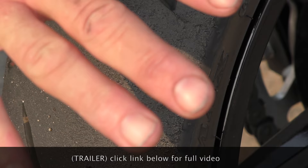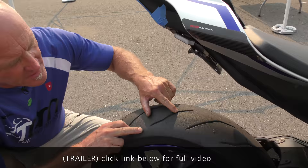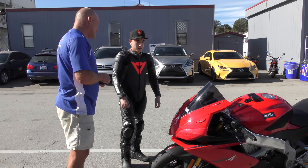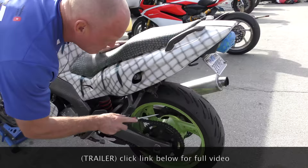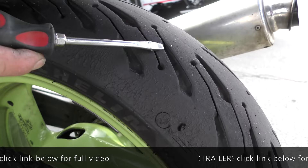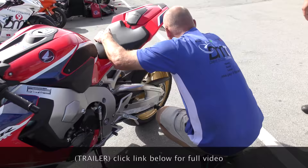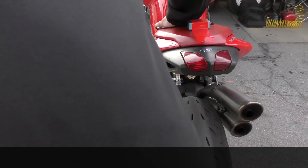We've got some S21s on this Yamaha. The leading edge is very tall right here, straight across — it feels like the rear is going to swing on you. What pressure is in the rear? 25 or 27 — so pressure is not the issue. The rebound on the tire shows it's very fast, but up here it's not, so this is from coasting. Excellent on the gas, especially partial throttle here to here.